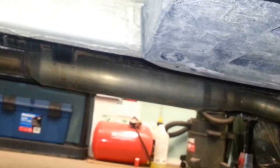And this worked quite well for me. I don't know where else I can use here. That's not straight right there. So that's what I use to level the vehicle. Obviously, when you're filling the transfer, the manual transmission, the rear diff, it's really important that it's level.